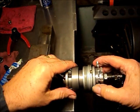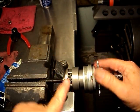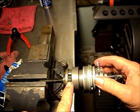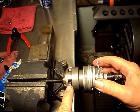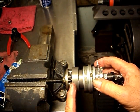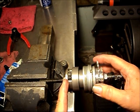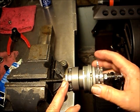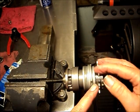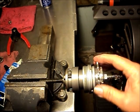Third gear: the clutch is coupled to the planetary, and you'll see that the planetary gears do not rotate because the engagement key has moved past the sun gears, so both sun gears are free to rotate. The whole unit is coupled together and we end up with one rotation input, one rotation output — direct drive, third gear.